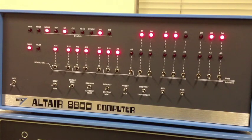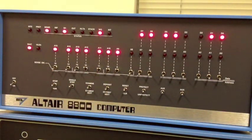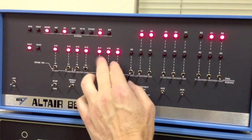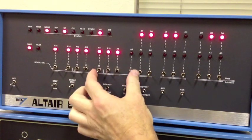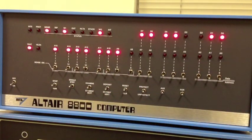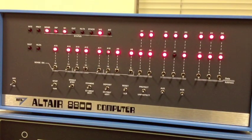To examine that address — this is the first instruction in that ROM ready to run. Before we run this, we need to tell BASIC what type of serial port is used for the console. These four bits tell it it's a 2SIO board with one stop bit; these four bits tell the loader what type of serial port is being used. We're going to set that to 011, which tells the loader it's a cassette hooked to the computer. In reality, all it really means is that it's using an 88SIO board at address 6 and 7. At this point it's ready to go, so we just hit Run.